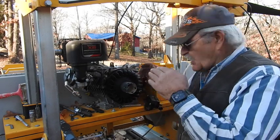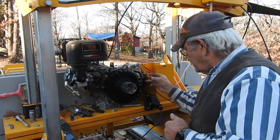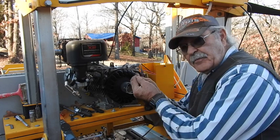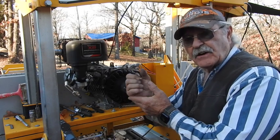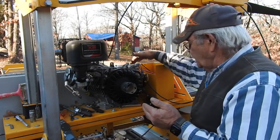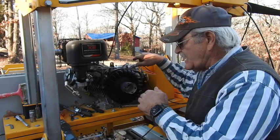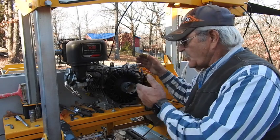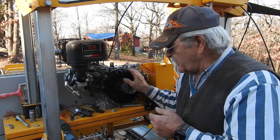To make a long story short, I went through this whole ordeal of pulling these off and doing every single one of them one by one. I actually had a couple of faulty connections in here — kind of a poor crimp connection. When I was separating the terminals, the wire actually pulled out of the little clip, so I had to reattach those wires, crimp them down really well, and make sure they're not going to give out again. I went ahead and had to pull the starter off in order to get in and do all that and see where all these wires go.